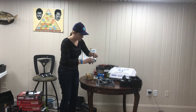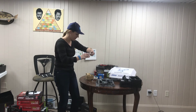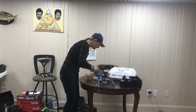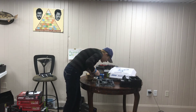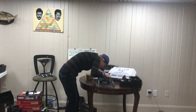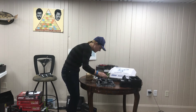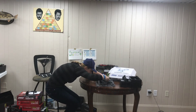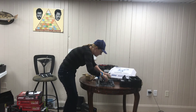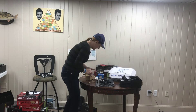I always recommend unwrapping the wire just enough so you can reach to plug in the CPU fan power. Go ahead and plug it in first, and then lock down your fan. Just look at the board — it'll have it clearly marked where the fan connector goes. I'm going to come down with all four corners and punch in. I think it helps to do the opposite corners — it gets it to settle in evenly.